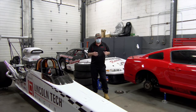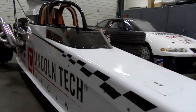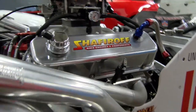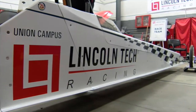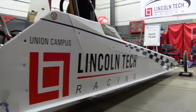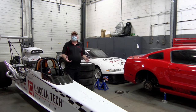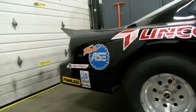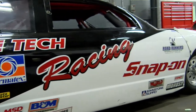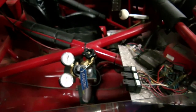They do all the necessary repairs and build the cars. Here we have our dragster — it runs on E85 ethanol, it's got a 565 cubic inch engine, and it's pushing out close to a thousand horsepower. It runs a quarter mile in roughly seven seconds at about 175 miles an hour. Behind us is the Pontiac, which is what started our race team. It's a very heavy car at 3,600 pounds — heavy for a race car — versus the dragster at 1,800 pounds. It has a 350 small block stroker engine punched out to a 440.